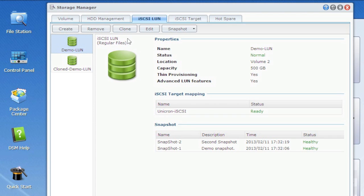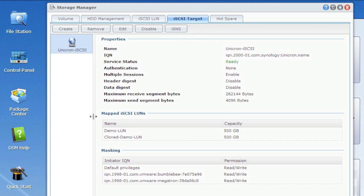But it's a great feature — I'm real pleased with it. Between this and the VAAI support, these are turning into really fantastic NAS boxes for small offices, even medium size, and especially here in my lab. The only other thing you would need to do is if you create a new iSCSI target, make sure to give your systems access to it. I don't need to do that because I've already got my initiators here, and we can see that it added both mapped iSCSI LUNs. So that's it for the demo — continuing to see great stuff out of Synology and looking forward to even more releases.